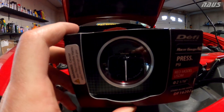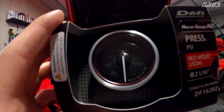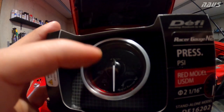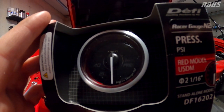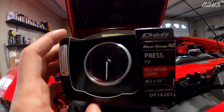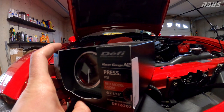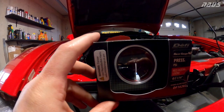I got an analog one. They have digital ones, but I wanted analog so you can see it in your peripheral vision — where the needle is. It should stay pointed straight up in the 90 PSI range when you're on track revving it out. In your peripheral vision you're not really going to see a digital number, but with an analog gauge you'll be able to tell real quick if your engine's healthy on the track.